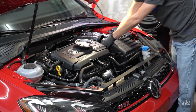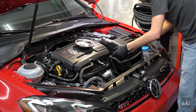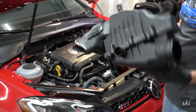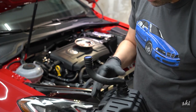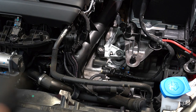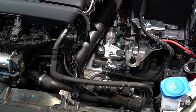I probably needed to take this off from this side. What is this for — is this just another breather? It's held on with these three little grommets. This must just be — I don't know if this actually hooks up to anything. Set that aside. Now with the air filter removed, we can see the stock shifter down there, and the bleed nipple for the clutch fluid, and the three posts that were holding up the air filter. When in neutral, you can actually push this down — that's the position you want before you swap it out.